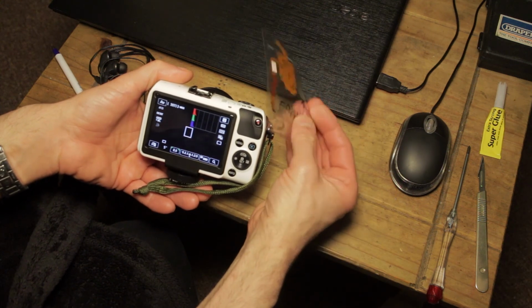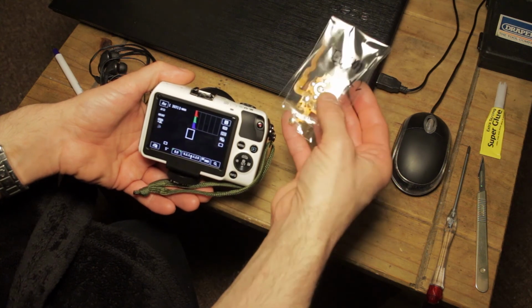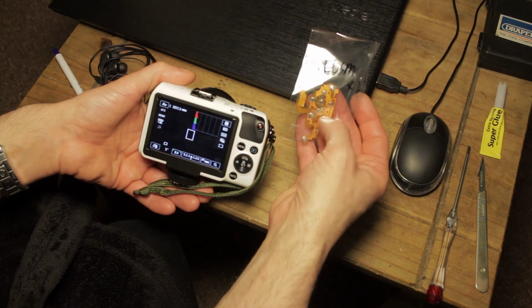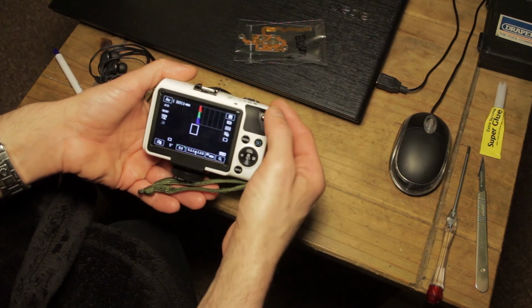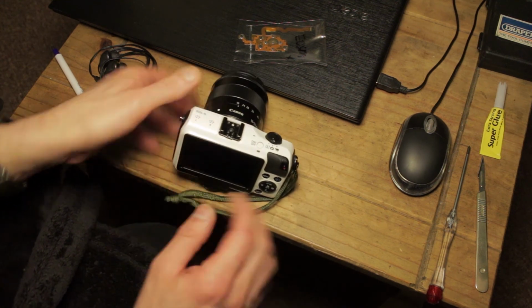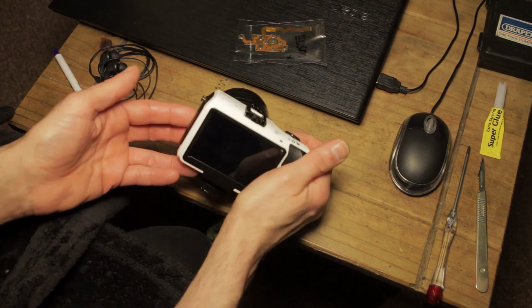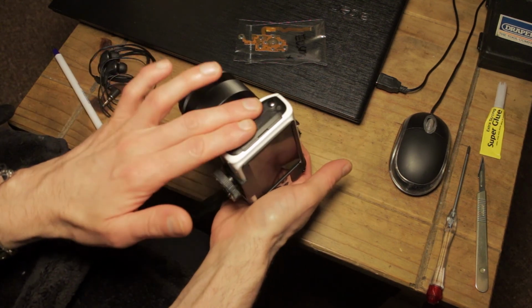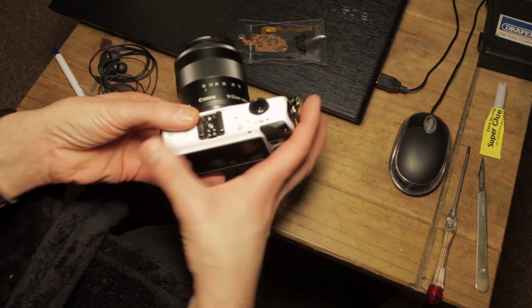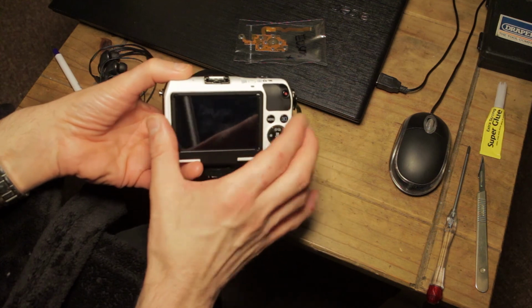Here's the new replacement ribbon cable. It's relatively simple, with these being the actuation buttons down here. And what we're going to do is turn this off, remove all the accessories and bits and pieces, and then take apart the camera case by removing the side panels on both sides, and then the screws at the bottom and the top, and separating the two halves of the camera so that we can get to the rear portion